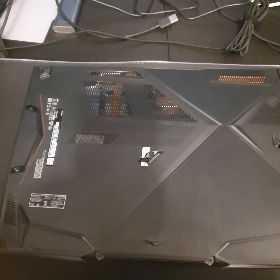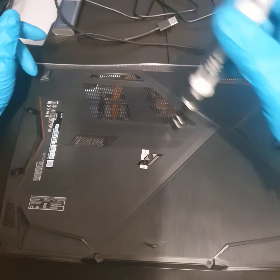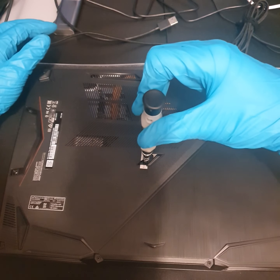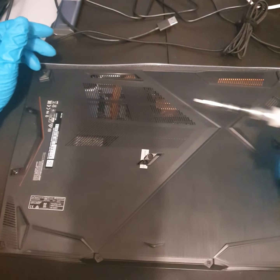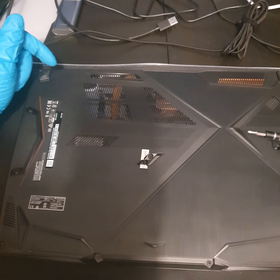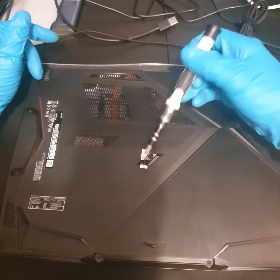When you're putting in the screws, just try not to over-screw them — don't round off the heads. If there's one thing I've done in my time of DIYs, it's round off a lot of screw heads. So just pretty much finger tight — if you've got two fingers on there and you just can't do any more, that's enough. Just try not to round off the heads. Not only is it going to ruin the screw and make it harder to get out next time, it will also perhaps ruin the internals of the computer because all these are linked and press on some items.